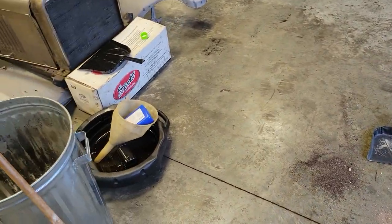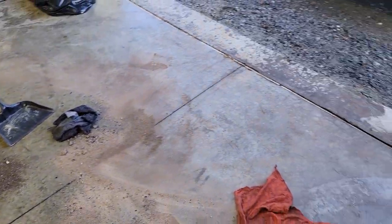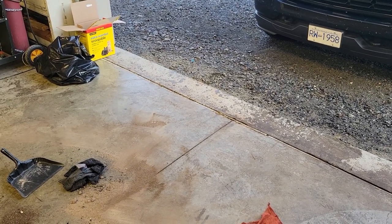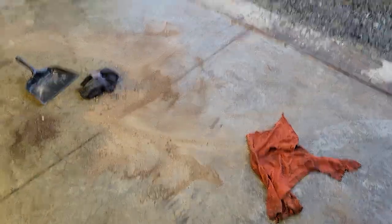So what I'm saying, guys — don't be an idiot like me. Make sure the ring from the old filter comes off the engine block before you proceed to pour eight liters of 0W-20 synthetic into your engine and blow it all over the bottom of your truck and the floor of your shop. I'm an idiot. Thanks for watching — hope you subscribe and pass the good stuff on. Take care.